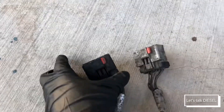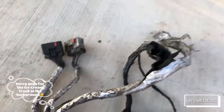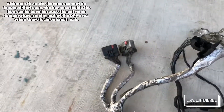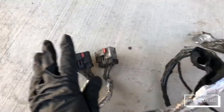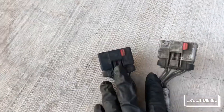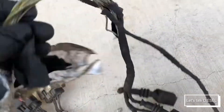The good thing about this section of the harness is it almost never gets damaged unless there's a major exhaust leak from the DPF filters, which rarely happens. These two connectors are just for temperature sensors, pressure sensors, and NOx sensors related to the aftertreatment filters.